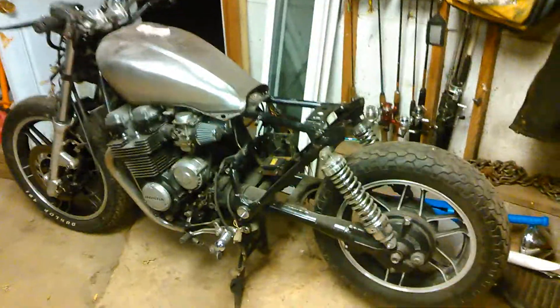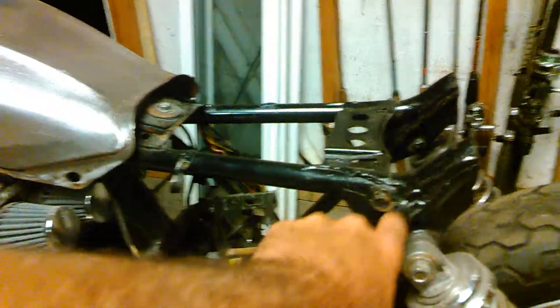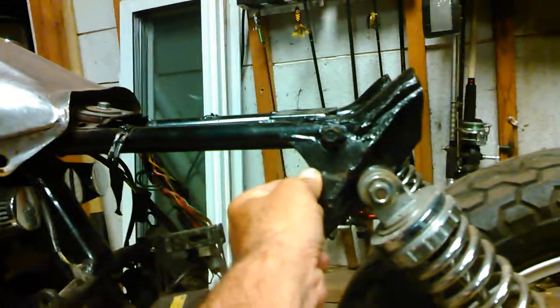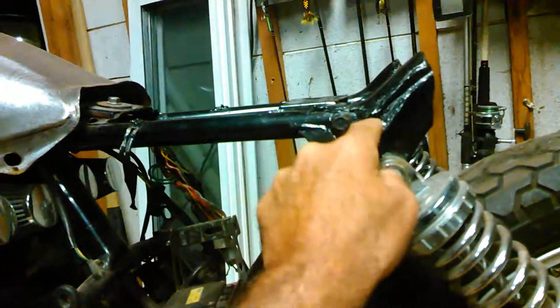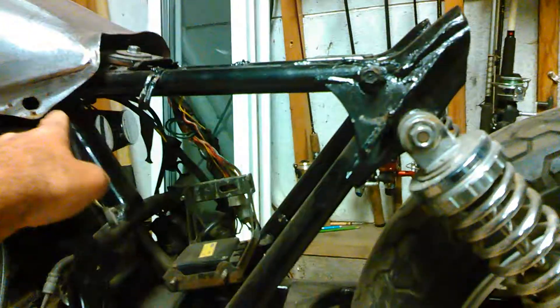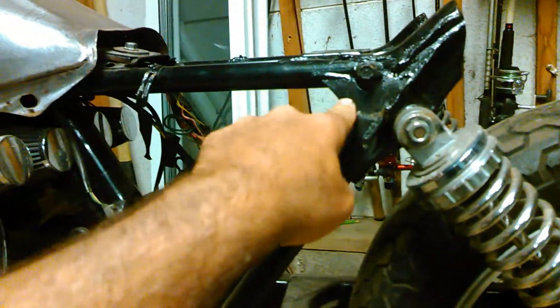Kind of got to take a crapshoot. But I'm about to cut most of this out right here. I'm going to take this whole fitting right here, this whole flange, whatever the hell you want to call it — I'm going to cut this out. I'm going to drop this down even with the shock. We're going to heat it and bend it down, re-weld it.